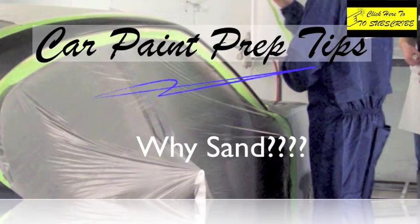And for spraying paint, manufacturers may vary a little bit, and this is in reference to solvent paint in this video, but a range of anywhere from 400 grit to 600 grit. So your base coat is going to fill those scratches. So 600 will work. It's going to take a little more effort. 400 will work as well.